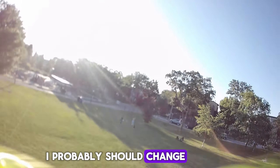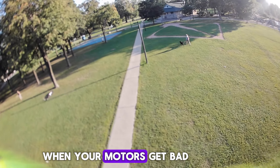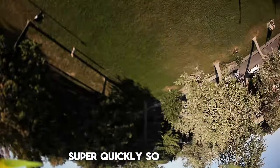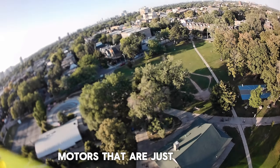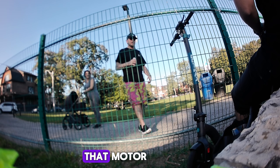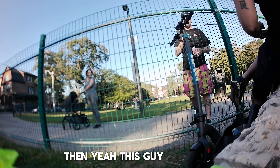There's another motor I probably should change but if it still flies decently I'll fly them until they're done. What starts happening when motors go bad — even if they can still fly — is your battery voltage drops from like 3.9 to 3.5 super quickly. So if you feel like your batteries are dying fast, it might be your motors. Go to the computer, spin them, and listen for shaking or vibrating. If a motor is vibrating in that range, it's time to change it.